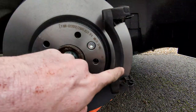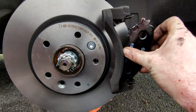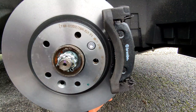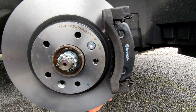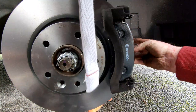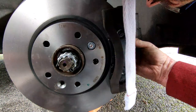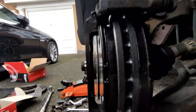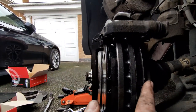You can see here the two runners at the top and the bottom. Push the pad into the bottom runner and into the top one and push it into place. The rear pad is effectively exactly the same - put copper grease on those two ends and they just go into the back part of the runner. Put the runner into one, into two, and voilà. Once you've done that, you'll see the pads sat either side - pad one, pad two - and they're also now holding the disc in place.